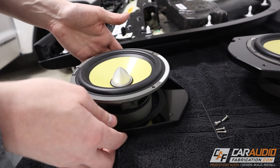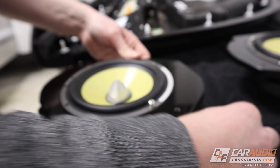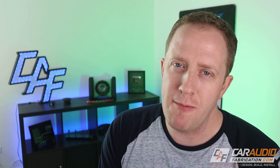You have to even pay attention to the simple stuff. The old saying, measure twice cut once, definitely applies. Two key areas I really want to emphasize: one is subwoofer mounting depth clearance. I see it all the time — people think they're going to use subs with a nine-inch mounting depth and put them behind the seat, but behind the seat they only have seven inches available. That's not going to work. The other area is speakers. Even if you're making a custom speaker adapter in the door, make sure you have enough clearance for that magnet to go into the door. Roll down that window and make sure the window isn't going to hit the backside of the speaker. Also when you upgrade to aftermarket speakers, that speaker generally has more excursion, which means it can get a lot closer to the factory grill of the door panel — make sure that speaker isn't slapping against the door panel. It's all about planning and proper measurement.